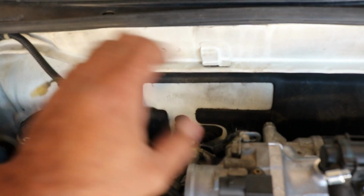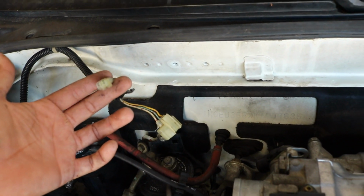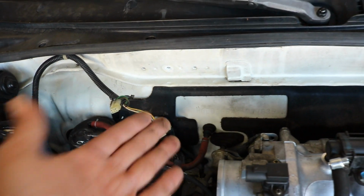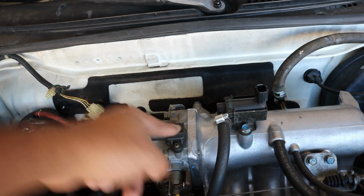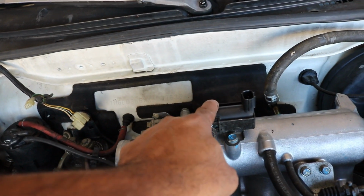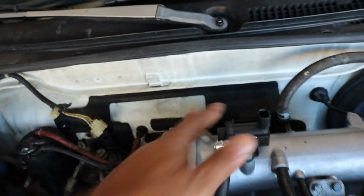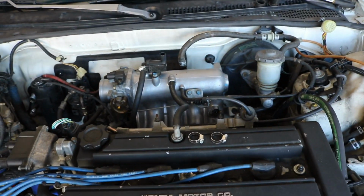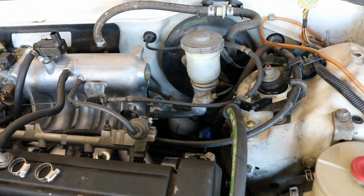on these cars, the map sensors are, you know, right here sitting on the firewall, and this is a map sensor plug, and this is for the evap purge solenoid. I don't know why they decided to put them on here, whereas on the new motors, the map sensor is here instead of on the firewall, and the purge solenoid is here instead of on the firewall. So these are easy enough, just cut them, extend them, get them to this spot, and that's pretty much it. As far as everything else is concerned, I mean, everything else is hooked up.